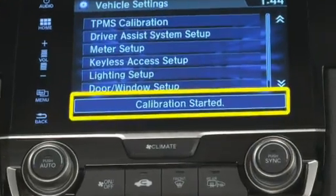I then see a Calibration Started message. And that's all there is to it. The TPMS automatically finishes calibration after about 30 minutes of accumulated driving going 30 to 65 miles per hour. I've shown you the basic steps in this video, but if you'd like to learn more, please refer to the Owner's Manual. I'm Valerie, and thanks for watching.